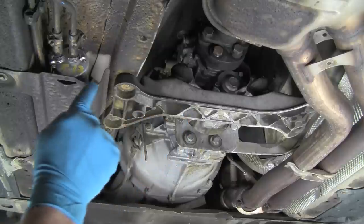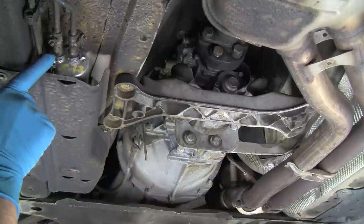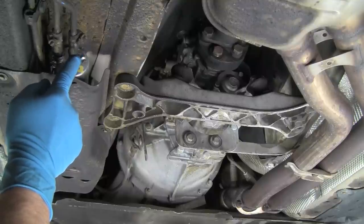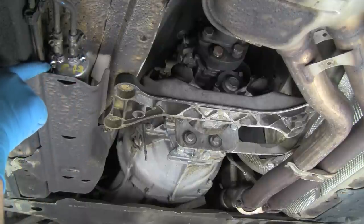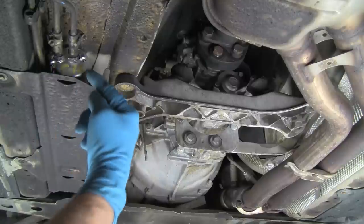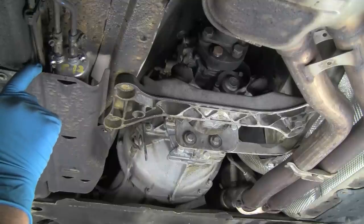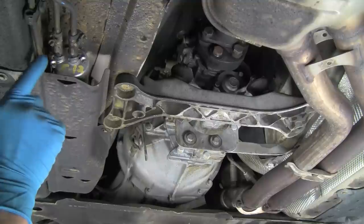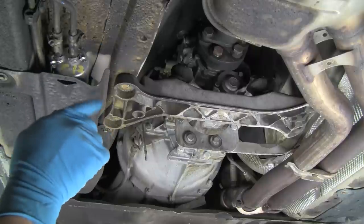While we're here, we can't inspect the fuel filter directly, but look at the rubber hose connections for any evidence of leakage or cracks. Look at the filter itself — this one is nice and shiny. It's been replaced recently and it's stamped 512, meaning it was replaced in the 5th month of 2012. This filter is still good for a while yet. Let's go ahead and look further back on the vehicle to the rear suspension.